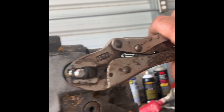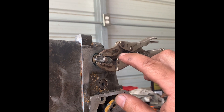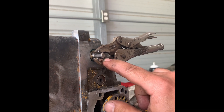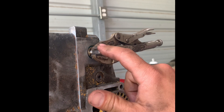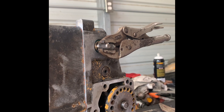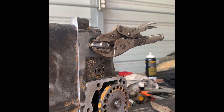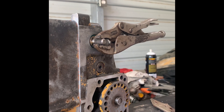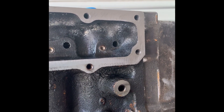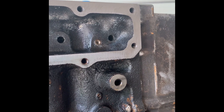Whenever you do this, there's always opportunity for something crazy to go wrong. So you always want to put — besides your electric shutdown — some locking pliers or some means of shutting this down manually. It wouldn't hurt to take the intake pipe off at the aftercooler pipe and have a big piece of plywood or pine board — something heavy duty that you can choke the air off with. Because it is possible to get these things out of control and they run away. Even as another fail safe, I like to have a paddle or something to choke out the air. And I keep a hammer as a last ditch effort to start knocking fuel lines off if it runs away, to try to save the engine.